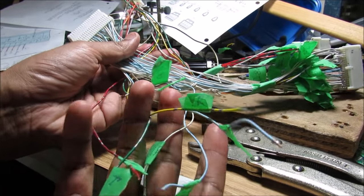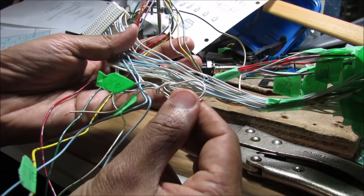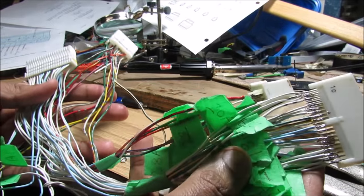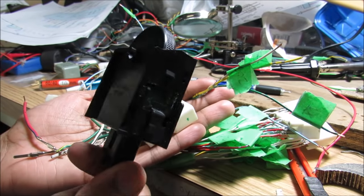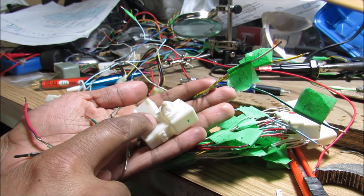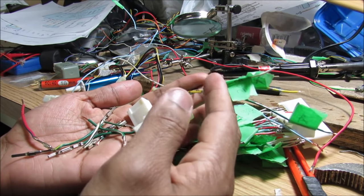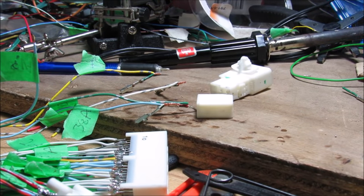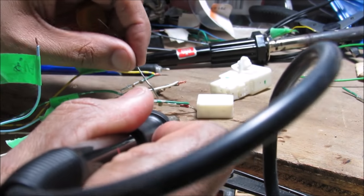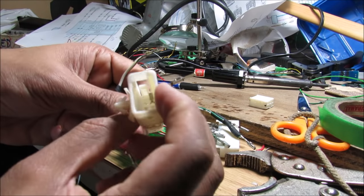I do have a few wires left over that go to the rheostat as well as two unknown wires and two wires that are not required, but other than that the harness is ready. Since the new instrument cluster is backlit it has a different rheostat that controls the brightness, so I'm going to use headers from a different pin that I've chopped off and solder the wires from the instrument cluster through this header to the rheostat for a plug-and-play swap. Here I've got the four wires going into the pin header, and I'm just going to push each pin into the connector until it clicks and snaps in.